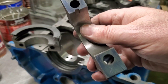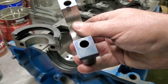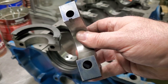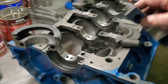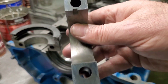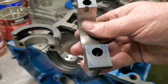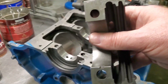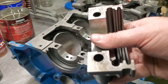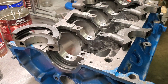Here you can see where I put blue on this cap and then sanded it on a surface plate. You can see where it's not touching the bluing — that cap was done on a belt sander. Here's another one: you can see where it's touching and rubbing the bluing off, and where the bluing still is it's not touching. We do not do caps that way. They put these on what was probably a belt sander used for surfacing cylinder heads — we don't like that.